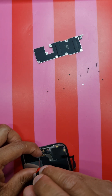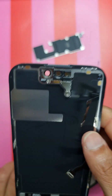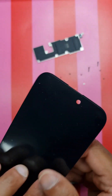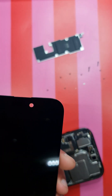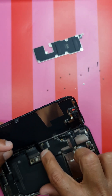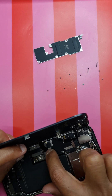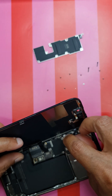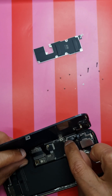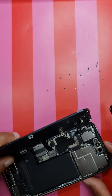That's how you change and move the flex over to the new screen. I've got the new screen and I've installed the flex on it. Let's connect it - as you can see it's a brand new screen. Take the screen protector off, connect your LCD flex, make sure your battery is disconnected, align it and press it down. Same thing with the other flex - press it down.